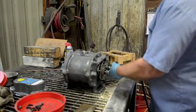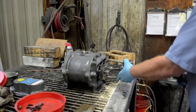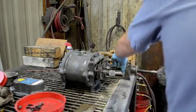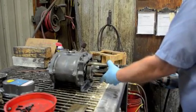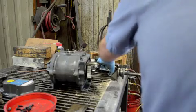Get an impact wrench on the gear lock nuts and get a gear puller. You don't want to take the lock nuts off all the way because we're going to actually be taking the gears off. Put some force on that puller and then strike it — that gives a shock load that will knock it off its taper and that gear will pop off the taper.